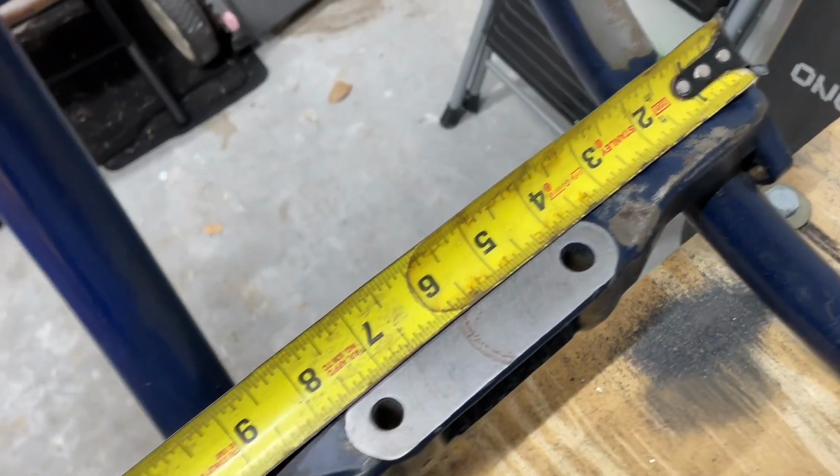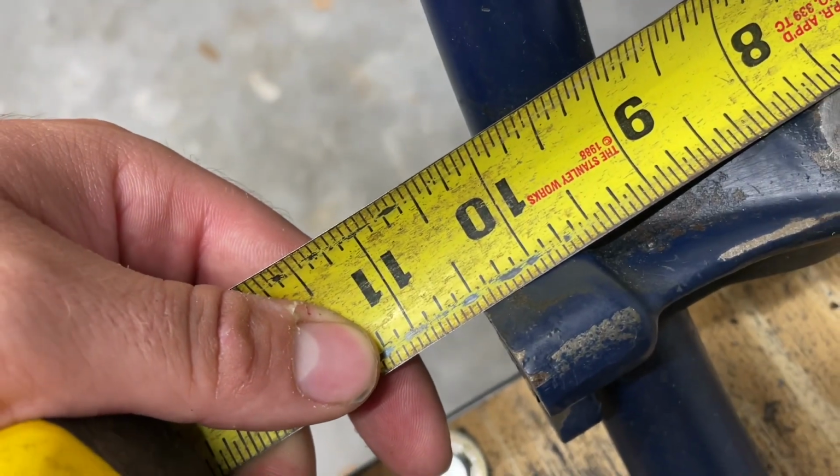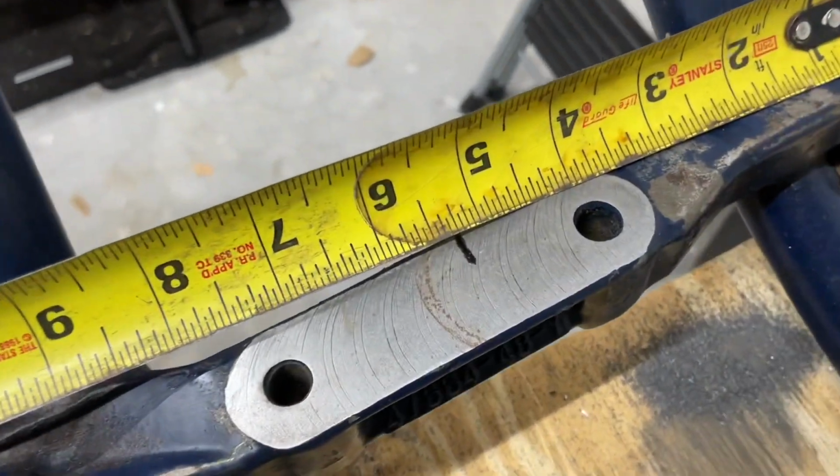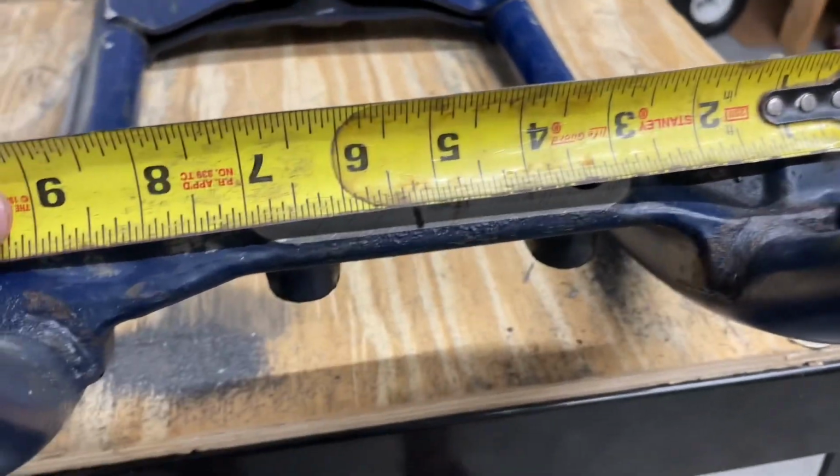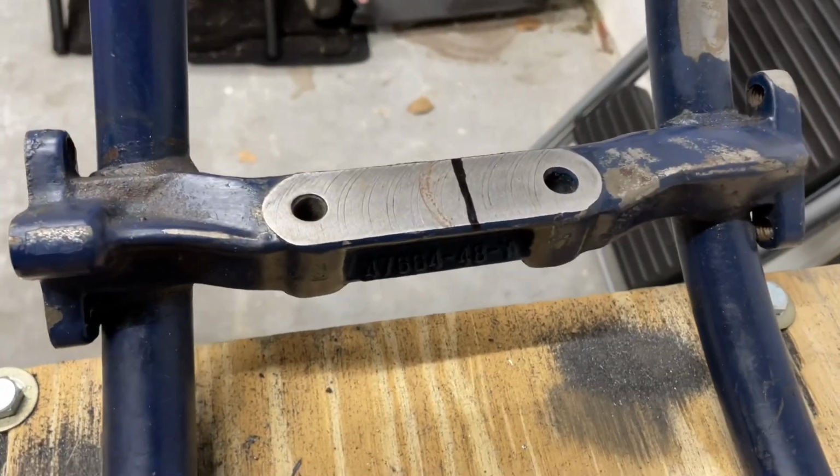And not like actually straight with the frame tubing, but perfectly parallel to the center on each side of the frame. Meaning this whole section is exactly 10.5 inches. So half of 10.5 is 5.25. So we have 5.25 off of this leg and 5.25 off of this leg. I'll make that line a little bigger just so you can see it. And yes, this is 4,362 times easier if you have a laser, but not everybody has a laser or has the money to go buy one. Poor man's laser. Man, back in my day, we didn't have any of them fancy schmancy tools anyway.